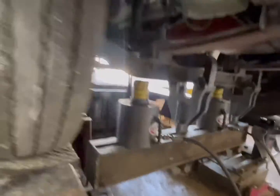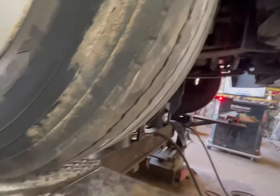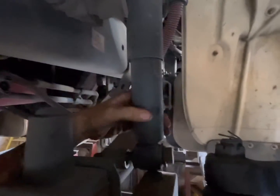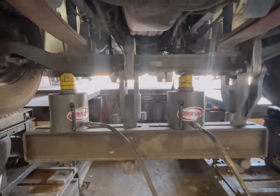Here's what our tires look like. The reason why we're doing this is because our tires are a little chopped up there — bouncing pretty good. With our tires the way they are, it's kind of showing an issue on both sides. Look right here — that shock isn't even tight, doesn't have a nut on it at all. So that's one of the things that will cause it. Another thing is our spring bushings may be bad, but this is a padded-type spring, as you can see in the back. But we're going to straighten this out and get her where she needs to be.